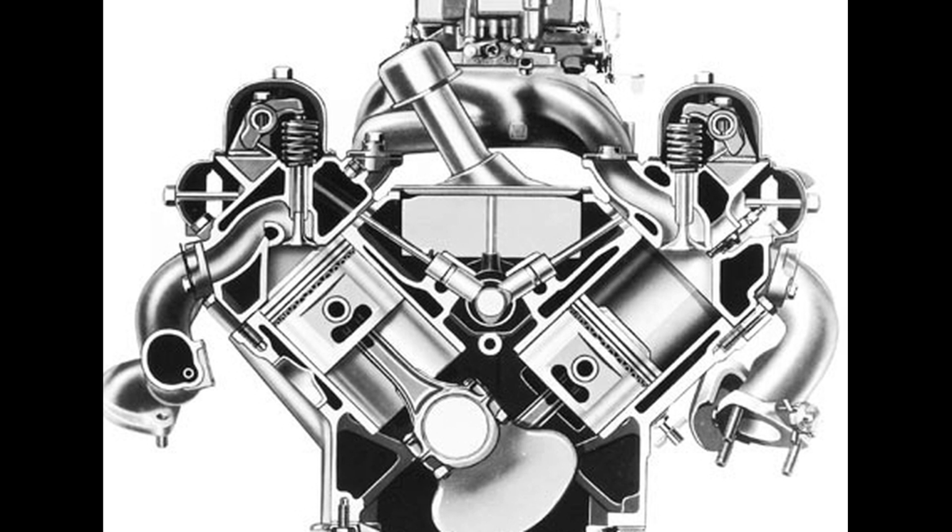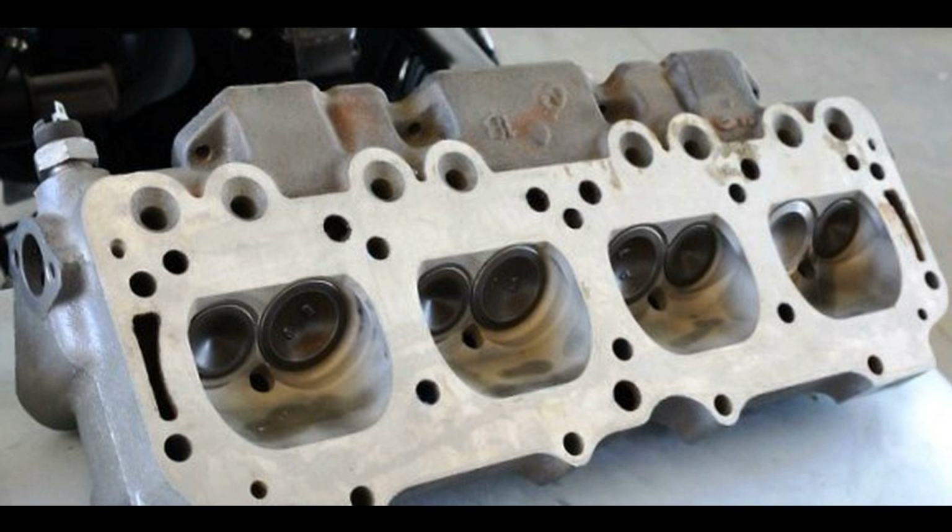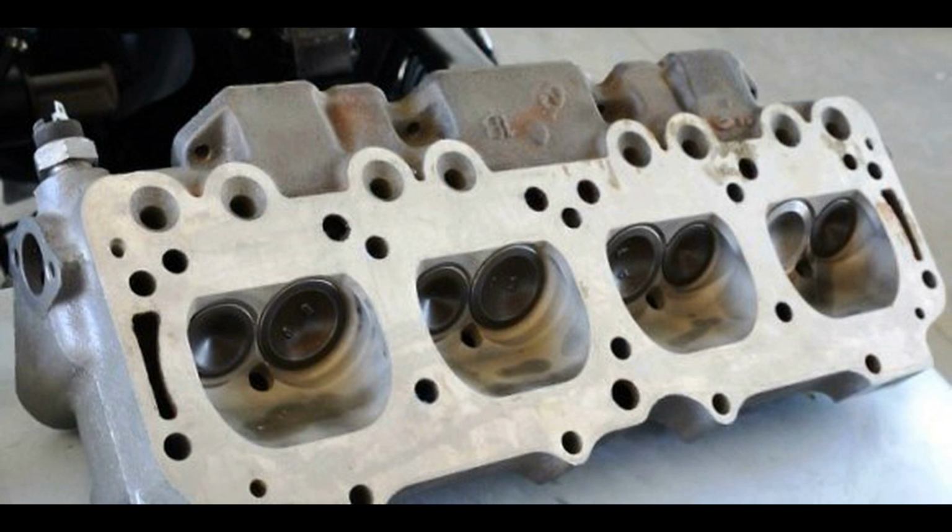Contrary to popular belief, the Buick small valves were not an accident or an oversight. They actually had a purpose, enabling a tighter, more efficient combustion chamber. Buick engineers were essentially trading volumetric efficiency and high RPM capability for combustion and mechanical efficiencies, a worthwhile trade in a road car. During the straight 8 era, engine development work at Buick had focused on airflow and camshaft lobe design, and the division was confident it could use these tools to provide decent breathing in the new V8 despite the smaller valve area. Ultimately, racers found that the small valves limited the engine's potential in high-performance, high RPM applications.